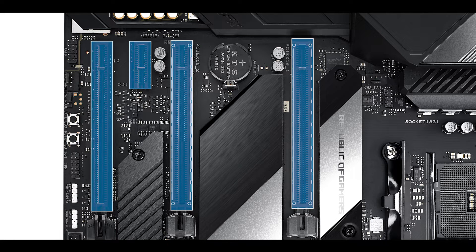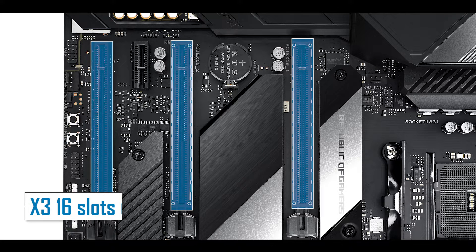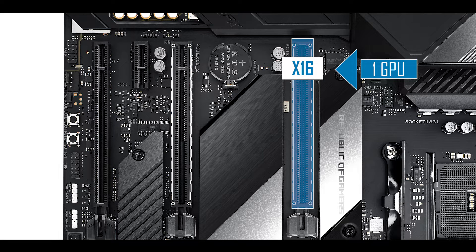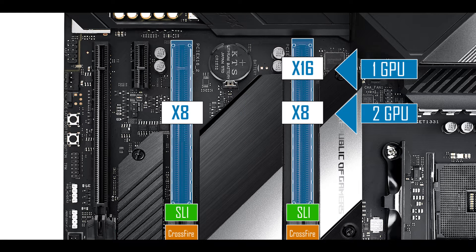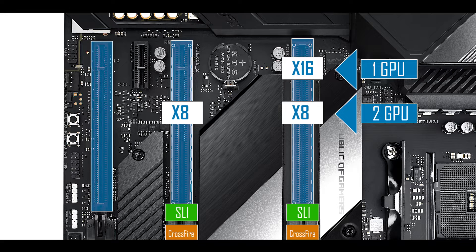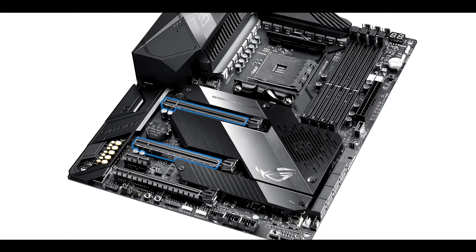Back to our layout: we have four PCIe Express slots — one single slot/single speed, and three x16 slots with different speeds. Only the first x16 slot can deliver up to 16 PCIe lanes, so for a single GPU configuration, that's where you want it for optimal speed. In a dual GPU configuration, lanes are shared giving us an 8x8 bus speed. In an improbable three-way Crossfire configuration, lanes divide further to 8x4x4. The two primary GPU slots have been metallically reinforced.